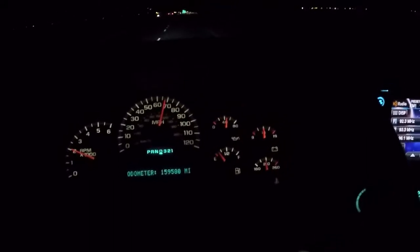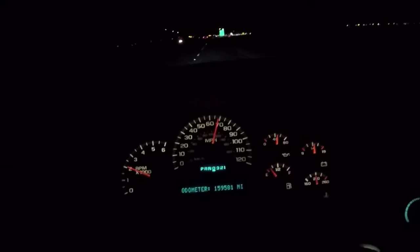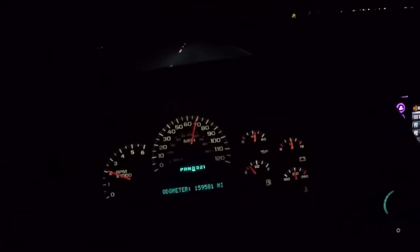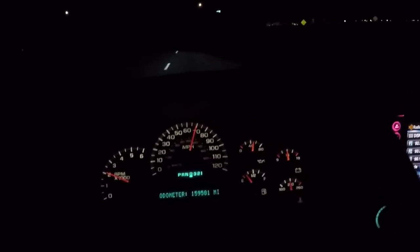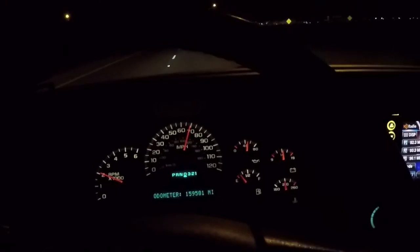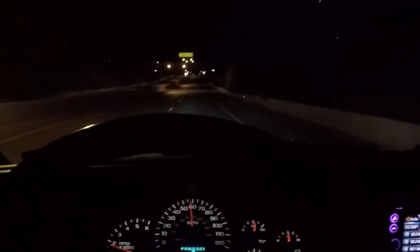We got to stab the transmission back into it, get it all lined up, bolt it back up, and then pretty much just start putting everything back together. Bolt up the trans again, bolt up the slave cylinder. We're going to do a steel clutch line tomorrow as well, so we'll do that. Bleed the lines. We got to put my exhaust back, all that good stuff. I will see you guys tomorrow.